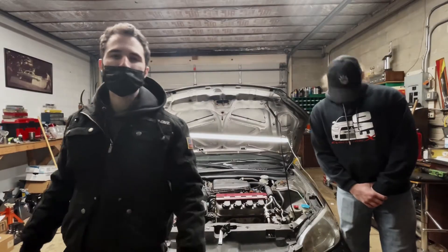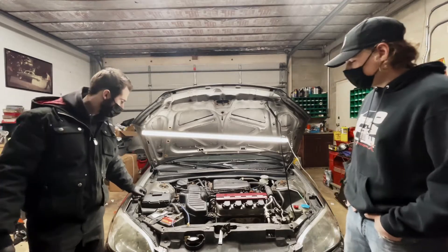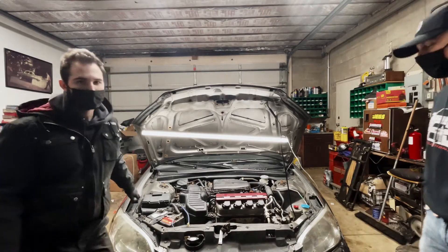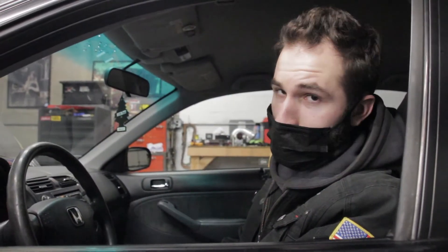What's good YouTube? This is Revolutions P. I'm here with your host Nick and Scott. Today we are back working on this Honda with a check engine light. Nick's got the scanner hooked up inside — let's go check out the code. We have a P1457 code, which is an EVAP control system leak, and this particular scan tool actually tells us that it's leaking near the canister area.